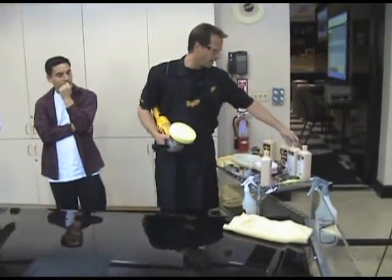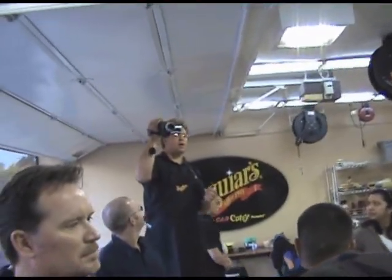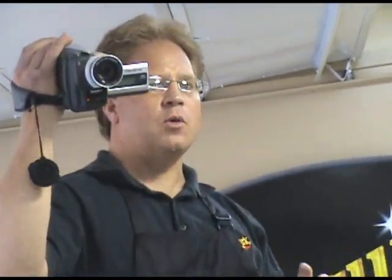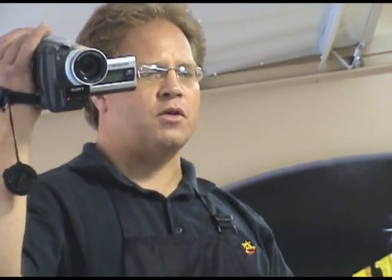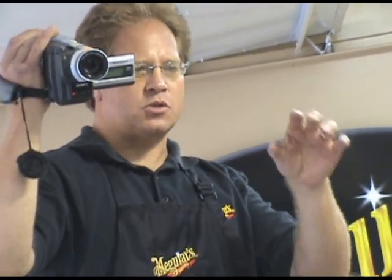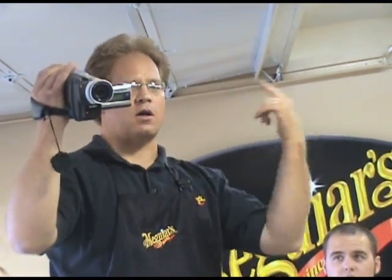Let's go. I'm going to try 80 just for giggles. Go ahead, Mike. On the forum, sometimes we talk about doing a test spot. In a real-world scenario, if you were working on the complete car, before you would tackle the whole car, say you're wet sanding or just removing serious defects, you'd want to dial in your system on one small area, make sure you can make that small area work well, and then once you dial in that system, you would duplicate that over the entire car.